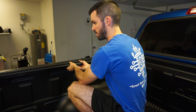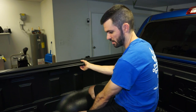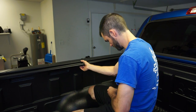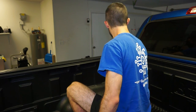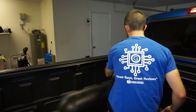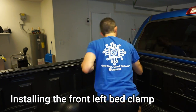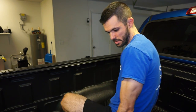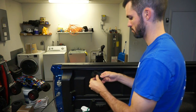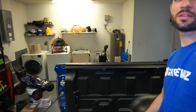I do have a plastic drop-in bed liner. I'm going to put in the center bed clamp first — and again, the instructions really aren't that great. That's going to basically clamp it on to begin with. We need a half inch. That's pretty much on there. Go ahead and put the other clamps on next. I'm not sure if I'm going to be able to use this torque spreader or whatever you want to call it, but I can try it. Let's do the last clamp on the back of this side. This side bed rail is on — it's solid, no worries.